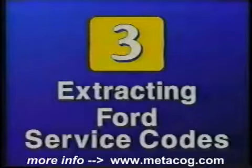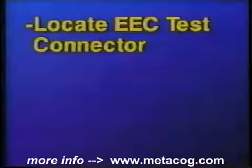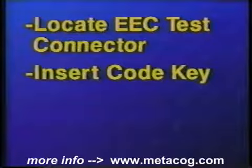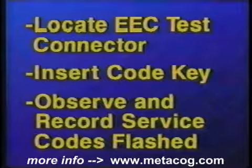Extracting Ford service codes is not a difficult task. These following steps explain how. Locate the EEC test connector usually found under the hood. Insert the code key and test light is shown. Observe and record the codes flashed by the test light or dash light.